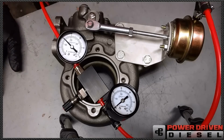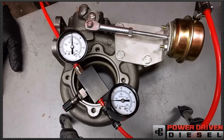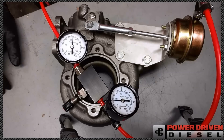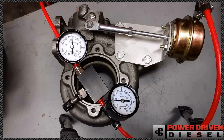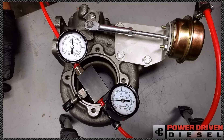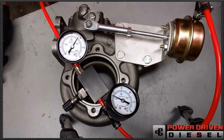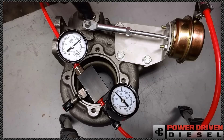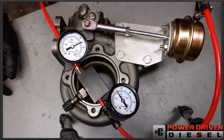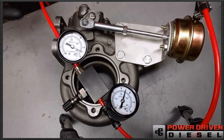Really good turbo response — it's moving up hard. We cracked around 23 psi it looked like. Let's get to 30 pounds of boost: at 30 pounds of boost we are at 10 psi on the wastegate side. This thing didn't let anything through until around 20 to 25 psi. So at 30 pounds of boost it's now just cracking a touch — you're going to make some good power. At 35 psi boost we're at 15 psi wastegate, just like before — as boost goes up 5, this goes up 5. It just matches itself. At 40 pounds of boost we're at 20 pounds wastegate pressure. At 45 boost, we're at 25 — so this is about 20 psi over on this setting. We're going to have to get about 55 pounds of boost to get our 35 psi here for full wastegate travel.